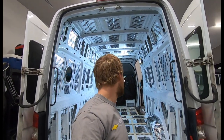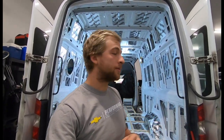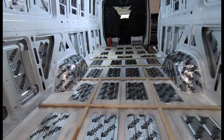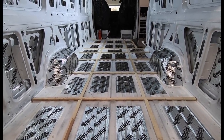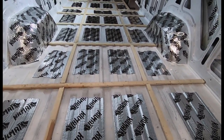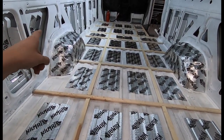What's up, guys? It's another weekend and we are back here. I'm sure you saw the first half of the video, what we did last weekend and what I did during the week when Morgan was gone. Well, I put in the framing and the floor, glued it down with some construction adhesive, and then I put the sound deadener on the floor and on the wheel wells.